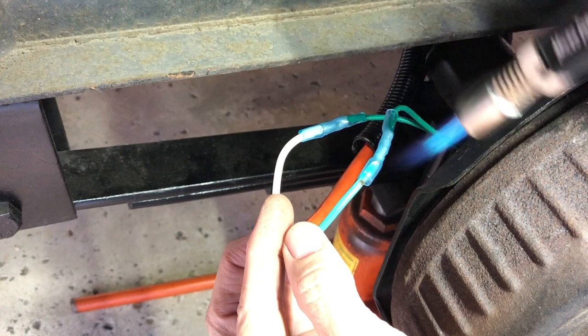Now here are the offending wires that we're suspicious of. There's the hole in the axle — these wires run right through the axle all the way across to the other side and pop out a little hole there as well. I'm going to pull these out now from both axles, take a look at them, and see if we can find anything suspicious. It'll be interesting to see if there's a visible tear in the wires that could be causing our short circuit.